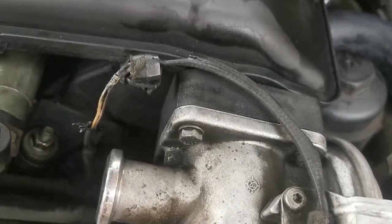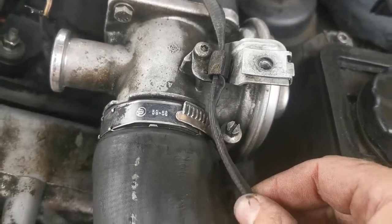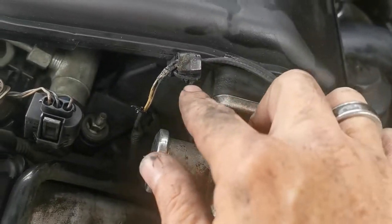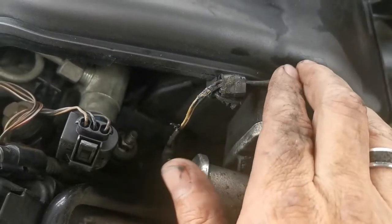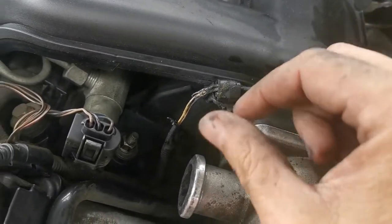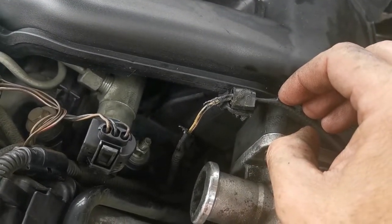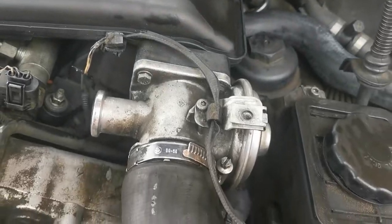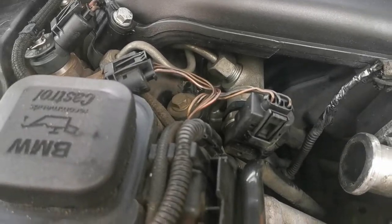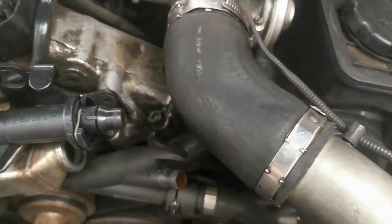While I was busy cleaning I realized the electrical cable that goes to the sensor was melted. The cable itself is fine — the wire is 100% — but the sleeving was melted away and melted into the electrical cable. Luckily the sensor is still working and the cables weren't damaged inside, but if I'd left it a bit longer I would have had a worse problem. All I did was take some insulation tape and tape it up. All the other wires look fine.